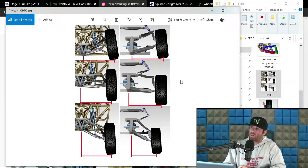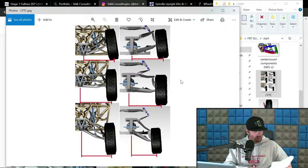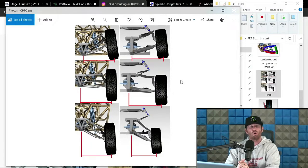And this one, as you can see, does have camber gain at compression. I would consider this relatively normal or mild camber gain at compression. Now, I also have camber gain at extension. The key here is it does not go positive. You definitely do not want positive, although there is an argument for that in some situations, and I will get to that slowly. But before we go into some of that talk, let's go with some general terms in the camber curve.